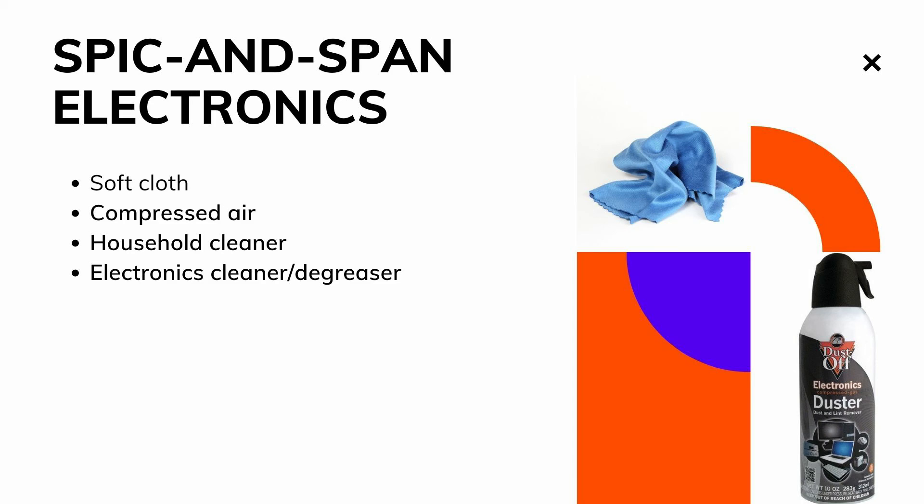Unless you know for sure that a mechanical assembly or part needs oil or grease, don't automatically apply it. If you're fixing electronics gear such as a VCR or CD player, check with the manufacturer for instructions regarding lubrication. There are two main reasons to avoid spray-on lubricants: first, you may have trouble controlling coverage — the spray gets on parts you don't want it to reach and makes a mess. Second, many synthetic lubricants are non-conductive, so the fine mist can settle on contacts that should be making electrical connections, and if the lubricant interrupts that contact, your circuit doesn't work.